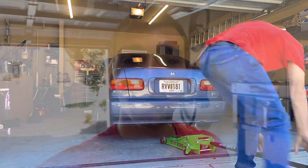I really appreciate you guys tuning in. I haven't tested it out yet to see if it fixed the binding. If you see a video of me replacing the top hat assembly of a strut, then you'll know it didn't work. But that's one thing you can do — just make sure your spring isn't so compressed that it's affecting the rest of the assembly. That's going to wrap it up for today. I'll turn the air compressor on, air up my wife's tires, and call it a day. See you guys in the next video.